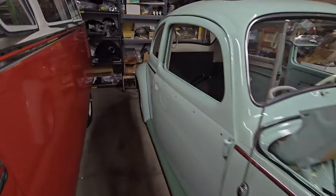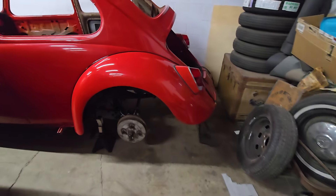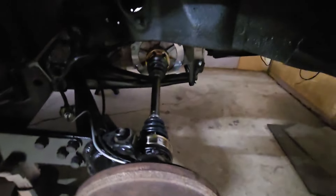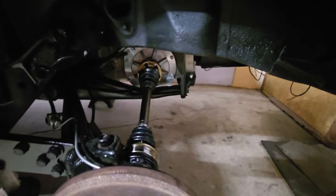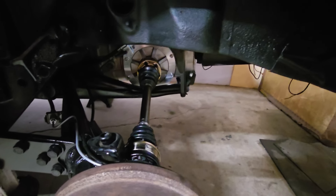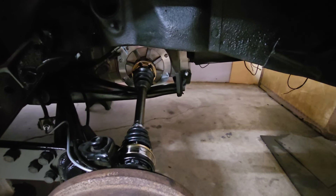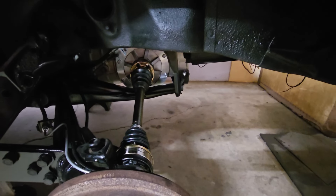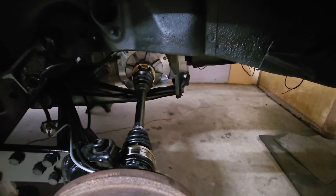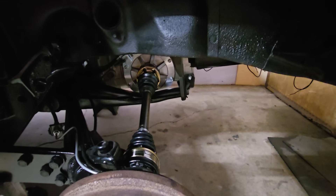Other than that, I worked a bit on the cowlick car, not a whole lot, but just trying to keep this car moving forward. I went ahead and installed the CV axles today. I went ahead and bought complete axles — it's just economically makes more sense to buy complete assemblies than to have me go and remove the old CVs and put on new ones and new boots and then grease them. It just doesn't make any sense. So I went ahead and put on whole new assemblies and got new hardware.